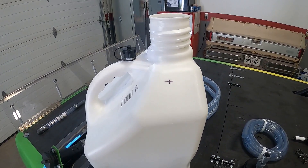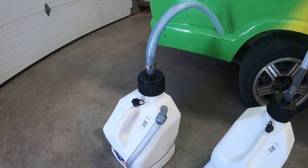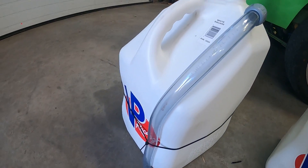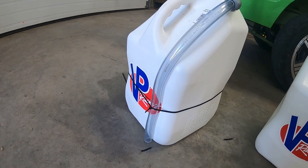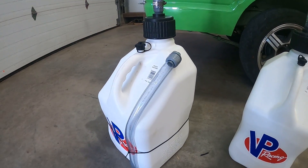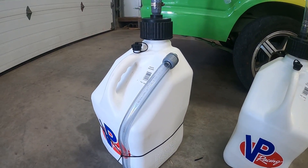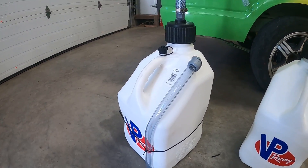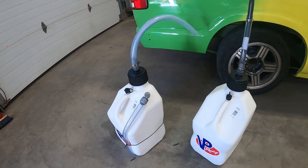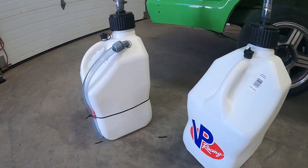So we grab the hole saw and put a hole in our brand new can. Not even five minutes of work and we've now modified this can. The big one-inch dump line is on, here's that fitting we were talking about, drilled the hole in there, and sent the vent tube down to the bottom so when you flip the can upside down the fuel doesn't come gushing out. Another reason to put the vent up high: when the cans are sitting full, the fuel level is actually below the vent, so you only have potential to leak on that O-ring seal while you're actively fueling — not when it's just sitting in the pits.